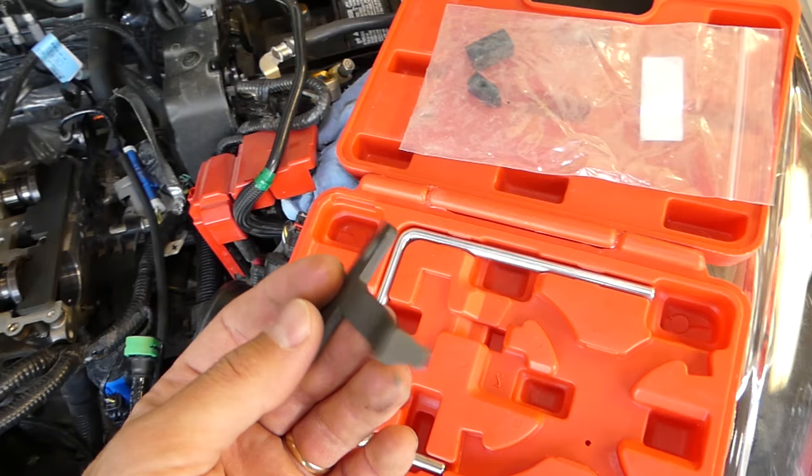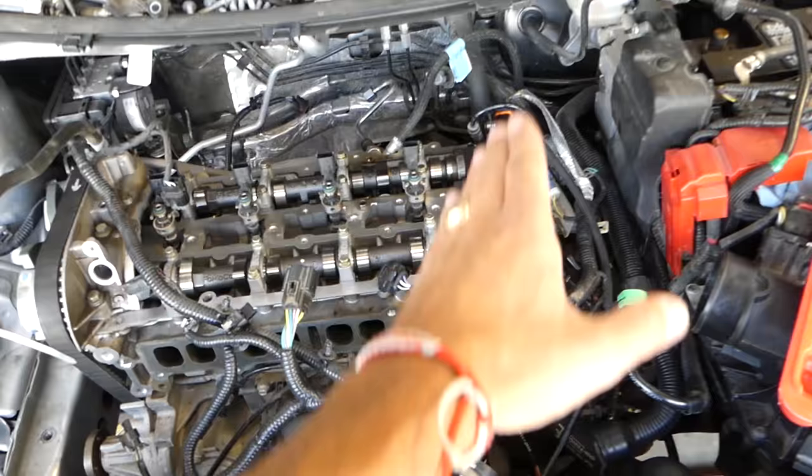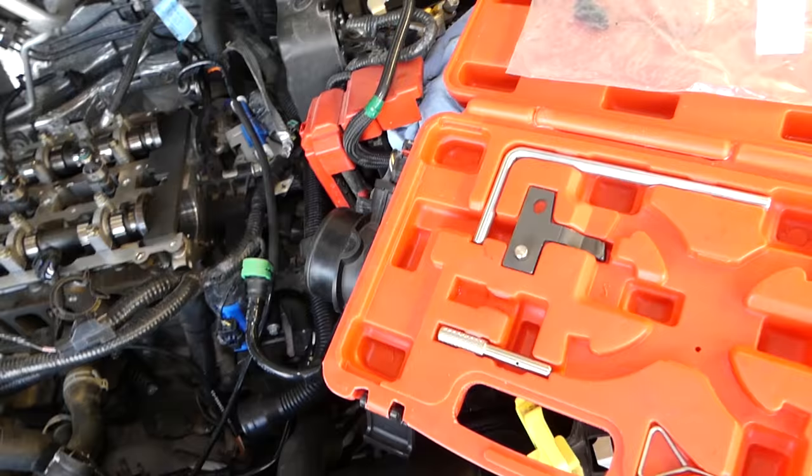This tool is placed where the crankshaft position sensor normally is. So those are the timing marks — you need to use a flywheel locking tool, the TDC pin on the back of the engine, the camshaft locking plate, and this crankshaft timing tool. That's how we do the timing marks on the Ford Escape 1.6 EcoBoost. Thank you for watching, please subscribe, and many more videos to come.